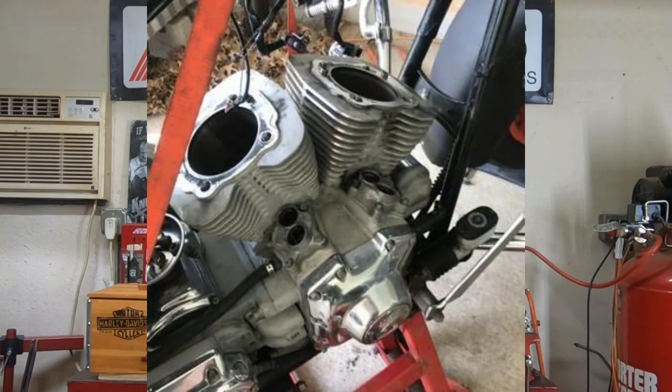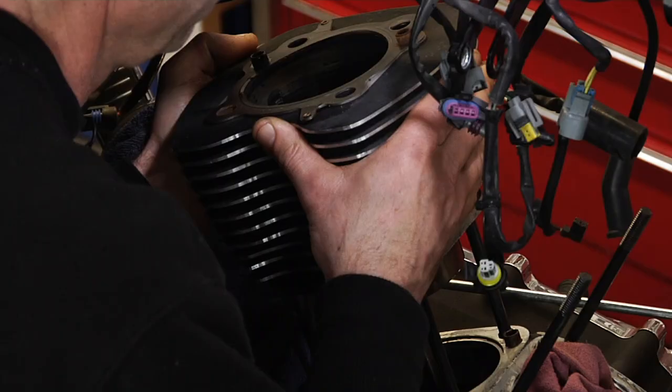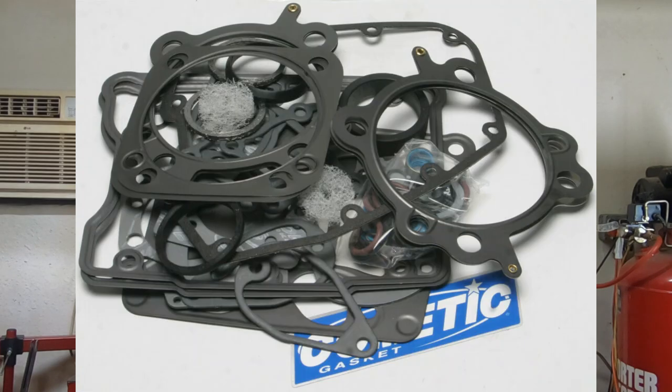When I say snugly, you're able to drop it in and you don't have a lot of play when you put that lifter down in that lifter bore. Now, when you're going back with gaskets, don't trip yourself up by cheaping out. I would recommend going with Cometic gaskets. Cometic gaskets are good enough that a lot of times you can even reuse them — like if you pulled the top end back off, you could go ahead and reuse them. I've heard of a lot of people doing that, but personally I'd go ahead and put a new set on there. Don't trip yourself up with cheap gaskets.